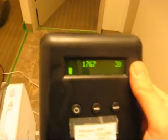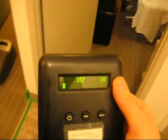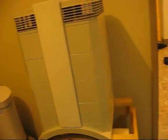It has very dirty air out there. Back in here, counts come down — they're higher than they usually are because I haven't had the air cleaners running all day, just so I can do my tests. I can't really test when the counts are too low; I have to purposely get my air dirtier. But we come in here and the counts come down. Quite impressive what this IQ Air machine can do. They claim it filters out ultrafine particles as well — a lot of HEPA filters don't touch the sub-0.1 micron particles, but this one claims to.